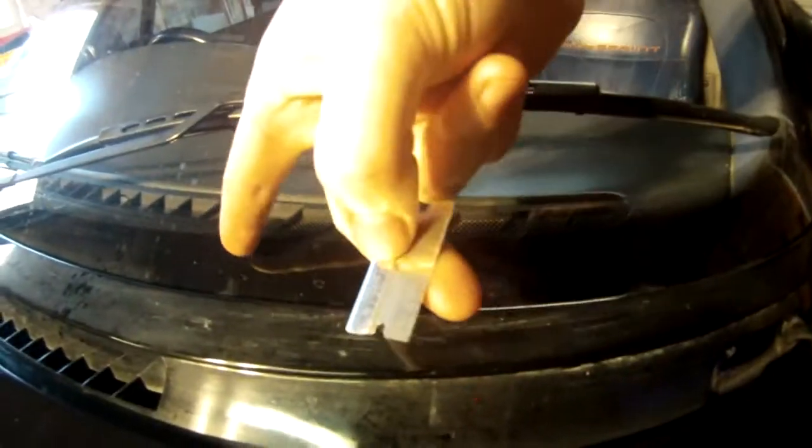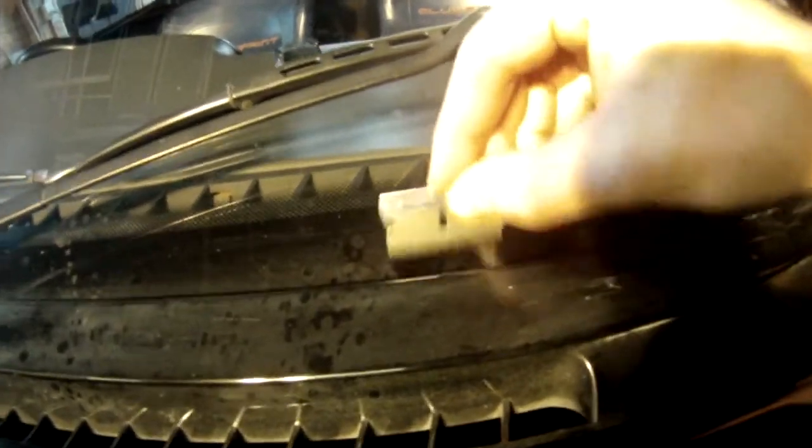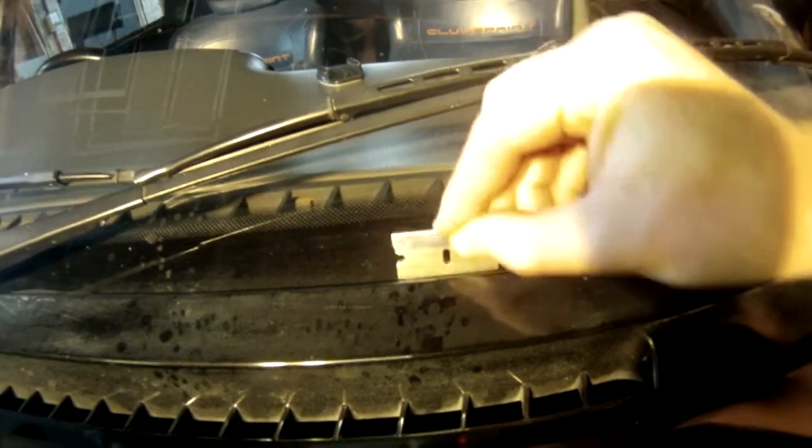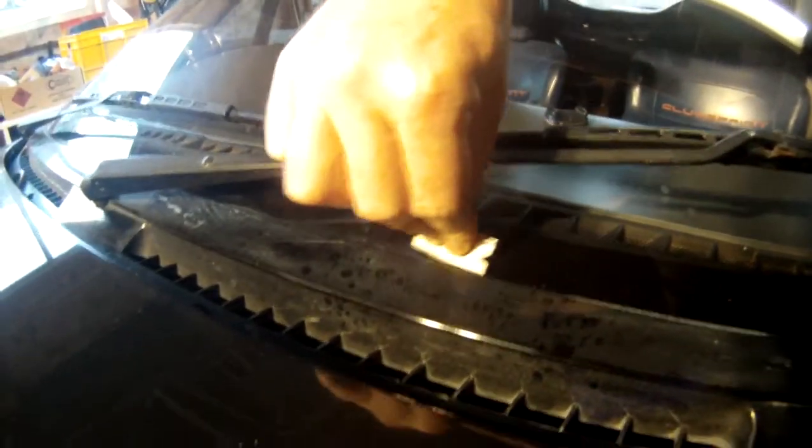The next tool that we're going to use to get rid of our overspray is a razor — very, very simple. I read this on the forums. Now this car's not the cleanest, but you can still see a little bit of the overspray left down here on the window. With our razor blade on the window, you can see that is actually coming off super easy. And that is just the easiest way — if you've got overspray on your glass, a razor blade is just so simple a way to get that off. And now your car looks new again.